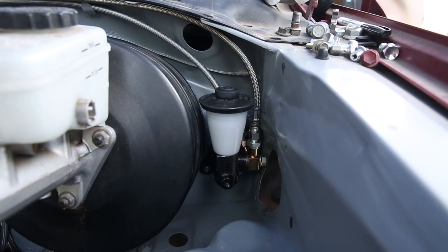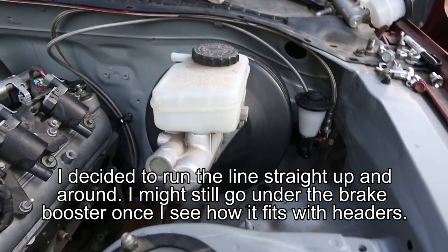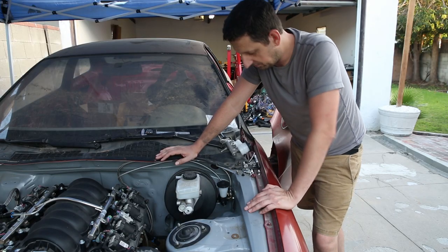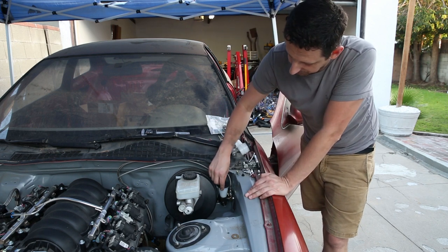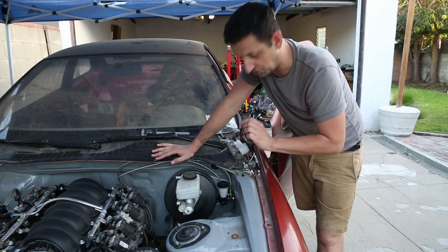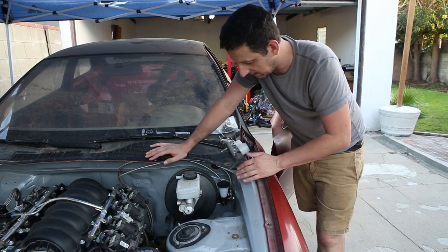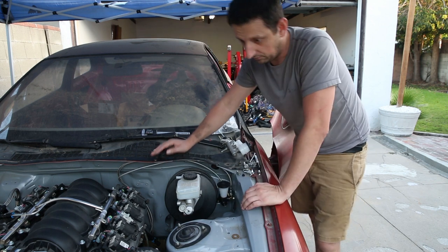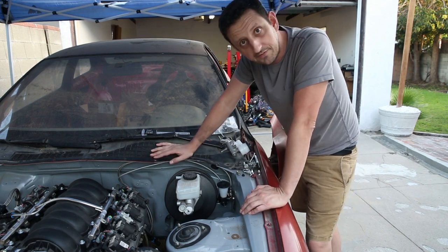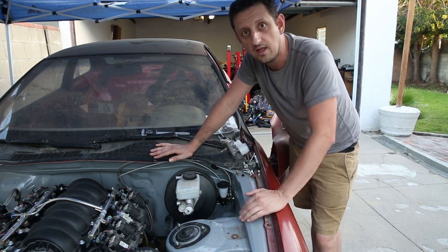So there we have our 3/4 inch clutch master cylinder all set up. This is probably the most cost-effective way to do a GM slave cylinder — using that 3/4 inch master for only $24 shipped. It took a bit longer than I thought to install, but we have the 1987 Land Cruiser master cylinder installed and bolted up to the SC300 chassis. Even though I had to do a bit more banging, bending, and repainting on my chassis, it does fit and I think we're going to have a great solution here. Thanks for watching — stay tuned for more Fully Spooled, we're getting that engine started really soon. See you guys next time.